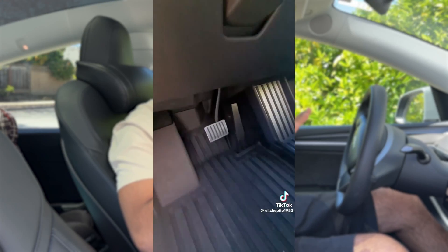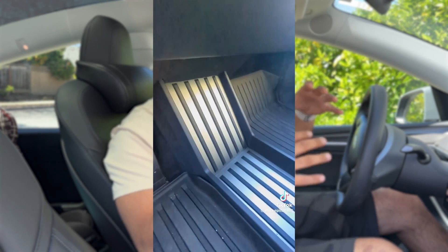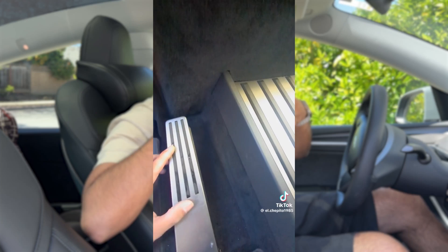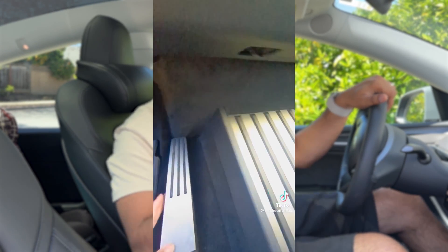That performance look is done by a piece that goes over the existing metal pedal. That piece is actually really hard to get on, but it can be removed and put on. In the Cybertruck, the accelerator pedal is hinged at the bottom, not at the top. This owner experienced, upon accelerating, the pressure his foot was putting pushed the pedal cover off. Unfortunately, the way the Cybertruck is designed below, there is a break in the floorboard where the carpet is, and that pedal got wedged in there, keeping the pedal down at full throttle — extremely dangerous.